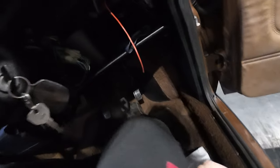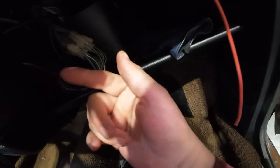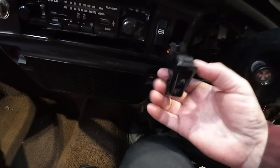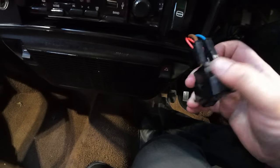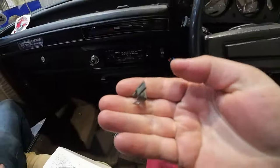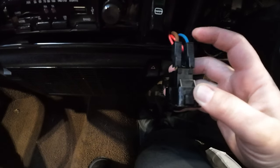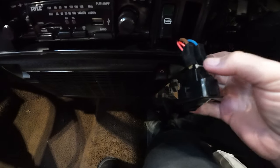So I've been looking at the wiring diagram, and somehow we need to get this blue wire attached to the switch, so the fog light will only power on when the lights are switched on. So Nick's just come over and helped me pull this switch out, because there's Mr. Blue. See, Graham's got this on here. This is for the side lights. This little piggyback, floating around in the box. Sorry, I don't know whether that might be useful. Yeah, very useful. Little piggyback. It's handy. Because I'd like to piggyback off of this connector, so we can have the rear fog come on with the main and dipped beam only, not the side lights.